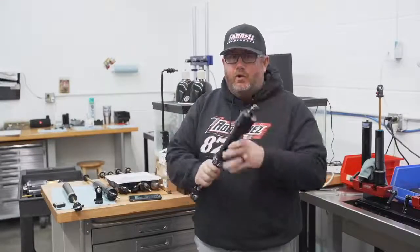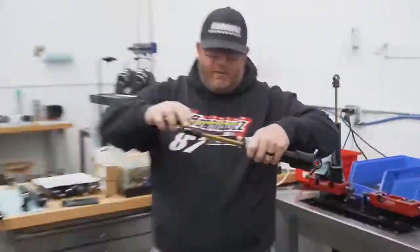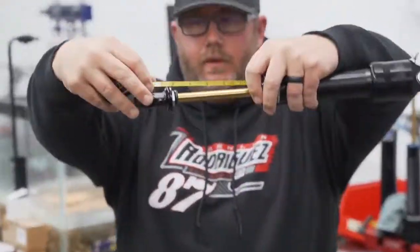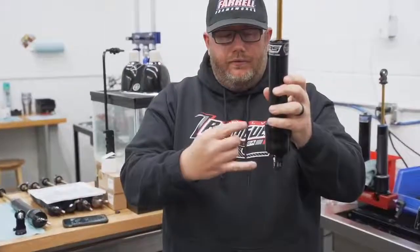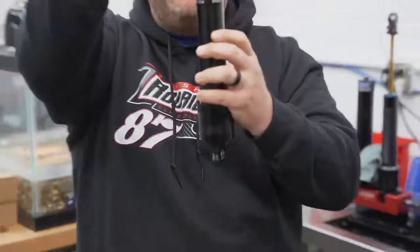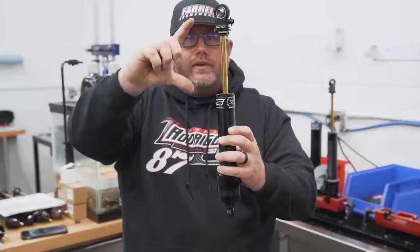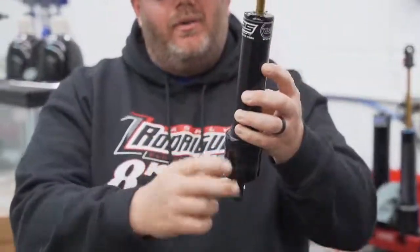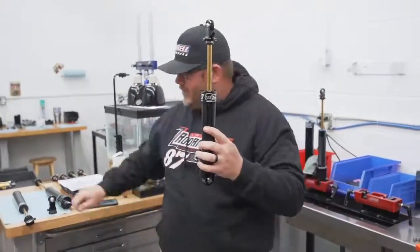This is an RS-17 small body monotube. When we say this is a 6-inch shock — actually this is probably a 5 — what we're actually measuring is 5 inches of available stroke. A 5-inch gas shock is going to have a longer fully extended center-line-of-eye to center-line-of-eye than a twin tube, because a twin tube body is shorter — we don't have this big gas chamber. The body is about three-quarters of an inch shorter on a twin tube, but it would still measure a 5-inch stroke.